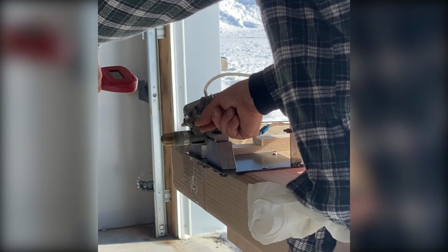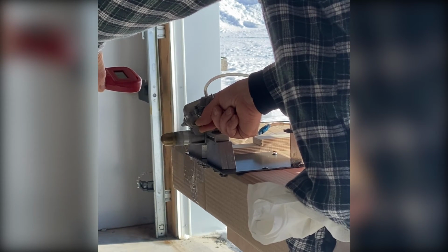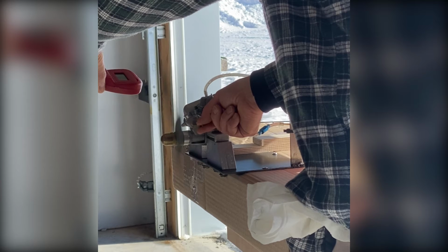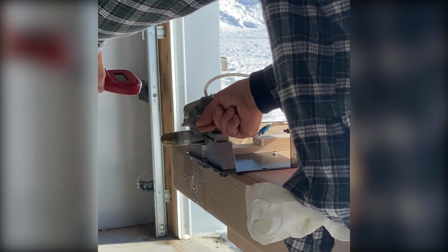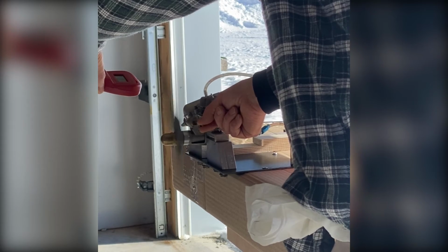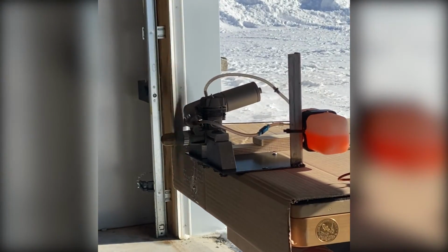With accumulating break-in time, you can vary the RPM of the engine by opening and closing the high-speed needle valve with the carburetor left to wide open. Sometimes it's easier to get it started if you shut the carb to maybe a third to half. But when it's running, open the carb and use the main speed adjustment to vary the RPM up and down while you're letting the engine accumulate some more runtime.